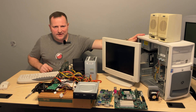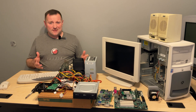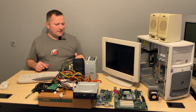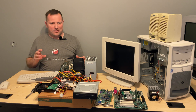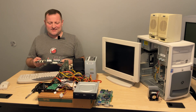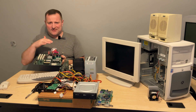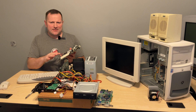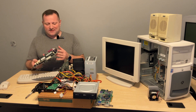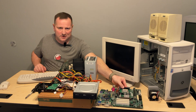Welcome back. Initially, I was going to install Linux Mint on this Pentium 4 Gateway tower right here. Unfortunately, about 15 minutes into the install, it just died. The power was still on, the fans were still spinning, but the motherboard itself was dead — I couldn't revive it. I pulled every individual component and put it back one by one, and nothing brought this thing back to life. I took the CPU out and turned it on; it gave the exact same amber light on the front — no life whatsoever to the board. I believe either the CPU died or it's got bad capacitors. None of them are leaking or bulging, but that doesn't necessarily mean they are good. That's somewhere to start with a board that is 22 years old. Early 2000s Pentium 4 boards were just prone to horrible capacitor damage.